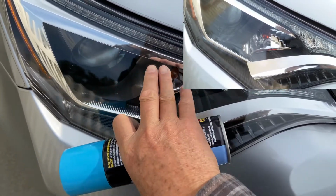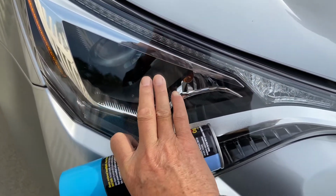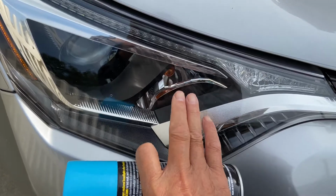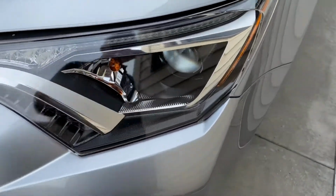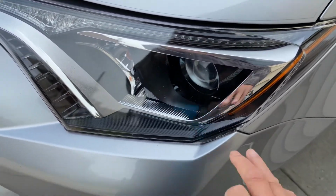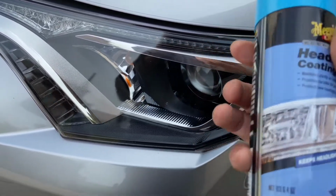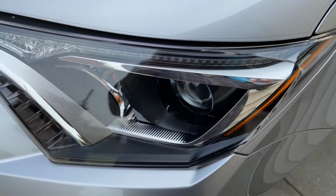So with the moisture, it sort of like makes it hazy, and I have to remove the coating entirely using isopropyl alcohol. So if your headlights are new, forget it. Wait until the headlight is really hazy or yellow before you do this, because there's some risk to this. Okay, thanks for watching.